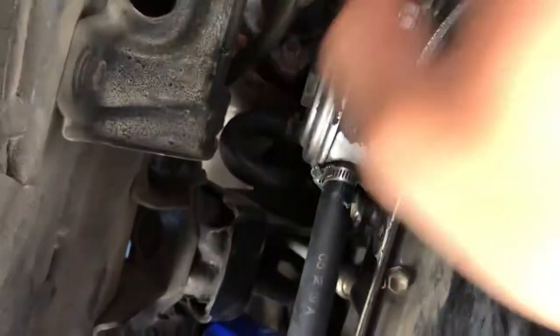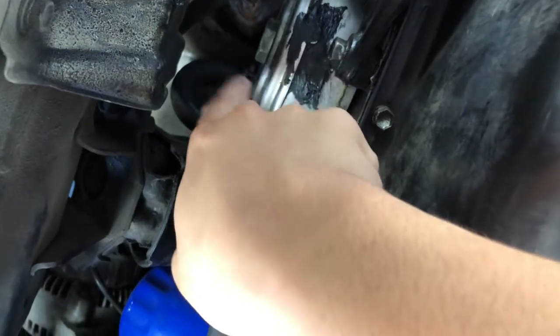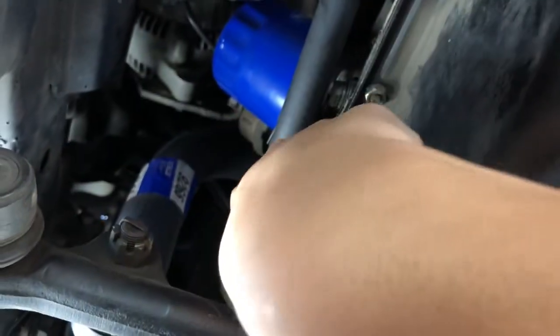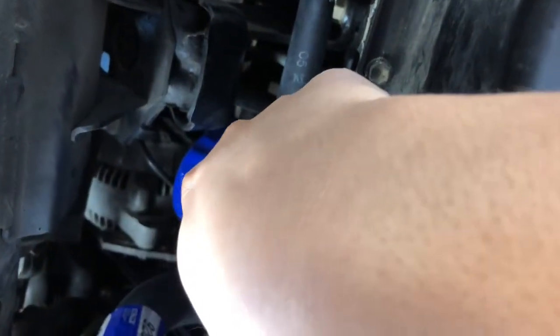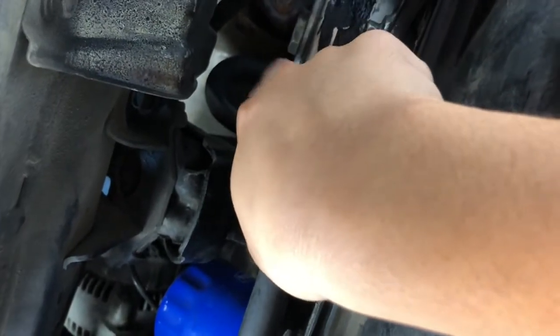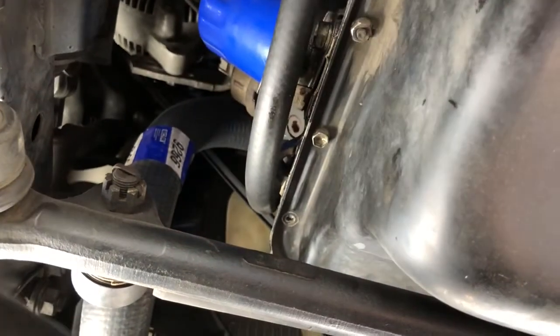So don't do whatever I did right there. What I did was check underneath today and I noticed there was coolant leaking on this hose right here, just a little bit. If you're wondering what this thing is, this is actually an oil cooler. It kind of baffles me because this hose is actually going to the outlet of that water pump, so it's technically coolant-related. If there are any Toyota enthusiasts with this exact same engine — whether it's the T100, the 4Runner, or the Hilux pickup — let me know what this thing actually does, because I don't understand why a coolant-related item is going into an oil cooler.